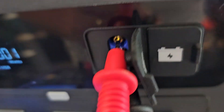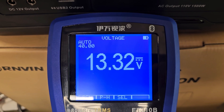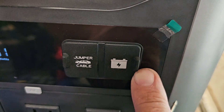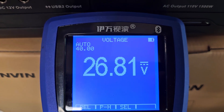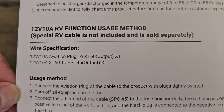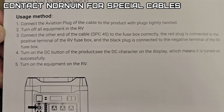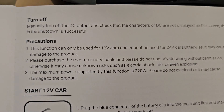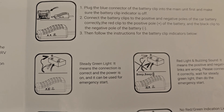The voltage at the jumper cable output is 13.32 volts, and you have a boost button on the cables you'd buy — when you push that, I'm sure it raises the voltage for a boost. On the external battery side it's 26.81 volts, so your external battery would have to be a 24-volt battery. For the RV connector — 12-volt, 10-amp — you hook it up and it'll supply 10 amps to your RV 12 volts. The optional plug, if you want to use the jump start feature and get the optional cord, it's basically the same as having a jump pack.